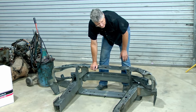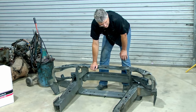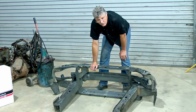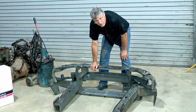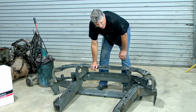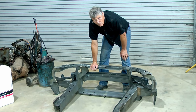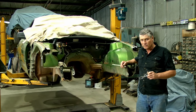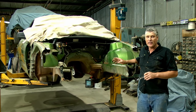If the battery fits in here, there's a brace underneath it. The likelihood that that would fail in an accident is so remote it's laughable, but you've always got to be prepared for the worst. If you're cutting up a car and welding a piece of another car to it, always choose the places where you cut and join it carefully. At the very least, if it's a car built this century or late last century, there will be a repair procedure floating around, and the internet gives us access to a lot of that.